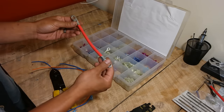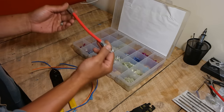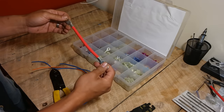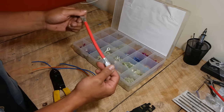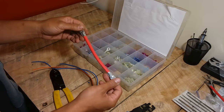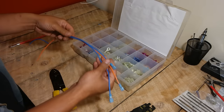The 6 gauge wire goes from your battery to your solenoid and then from your solenoid to your starter. This gauge wire is also used for the negative side of your battery, going from the battery to your engine ground or common ground — and of course that would be black. But for the most part, for all the other wiring, I use 14 gauge wire.